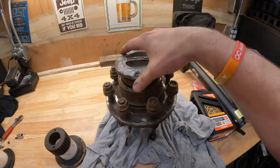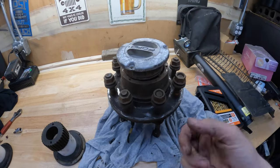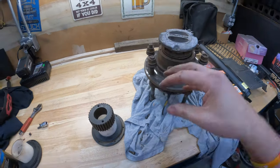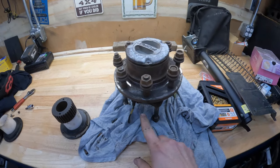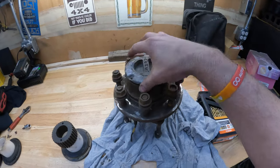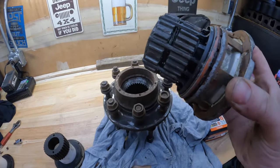That's too deep for me. But basically, in the off-road world, you want all four tires spinning. Get in the vehicle, pull the transfer case into four-wheel, either low or high, turn this from open to lock, and bam, all of a sudden it's connecting the axle shaft to the hub, and your tire is turning. Now, there's some belief that these things are really good fusible links, and they are.